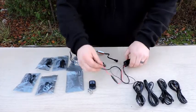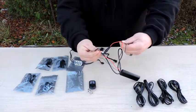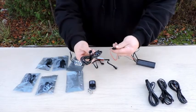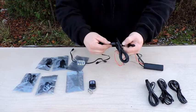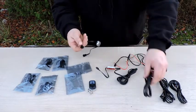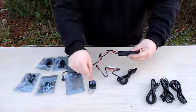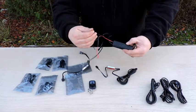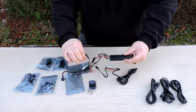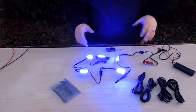These are really simple to hook up. You get your power wire and a ground inside your vehicle — car, razor, whatever. One lead comes out of the controller and you plug it into either a pod or an extension harness, then plug your pod into that. The next pod plugs into that pod, or you use another extension harness depending on how far apart you want to space them. Mount the controller somewhere, route the antenna wire away from the module to avoid interference, strap it up, and you're ready to go.